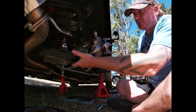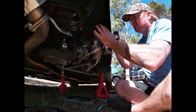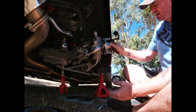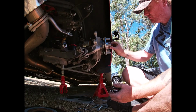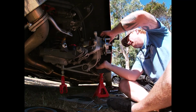So all I did is started by putting this lower control arm in and pulling the upper in, and I just kind of brought everything up and in, and then the half shafts in. So I'm just going to get the 32mm bolt and just place it on by hand, just so everything kind of stays together. And the vertical link I'll try to get in.